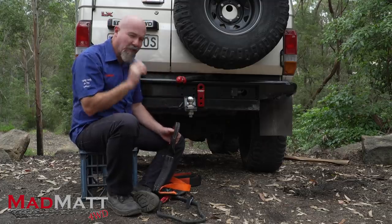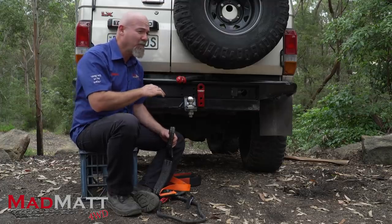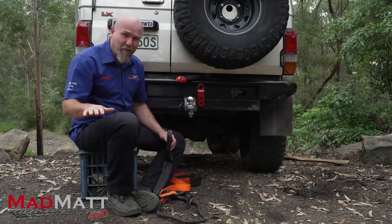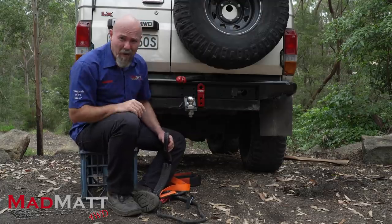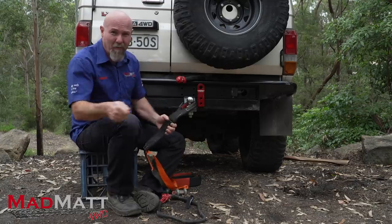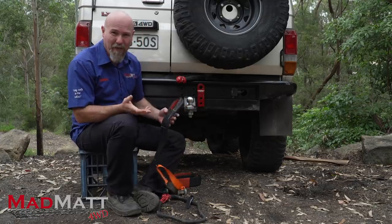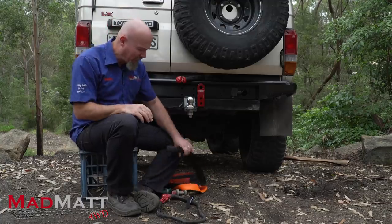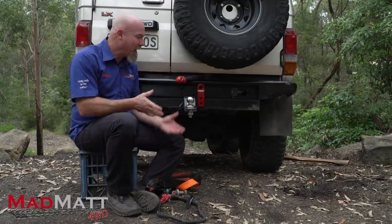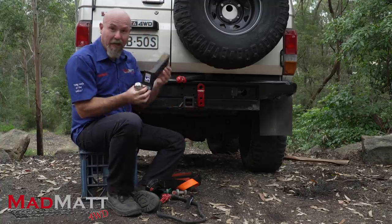There are a few exceptional times where you may consider it — say you've got a vehicle stuck on a flat surface on ice, it's got to go one metre, and you're not even really going to put any force in there. You hook a strap on and you might drag it off with five guys. Yes, there's not much energy, but that would be about the only exception. For the most part, it's not worth using a tow ball or a hitch like this to recover off.